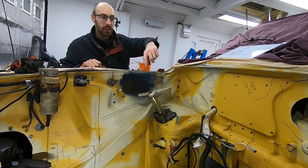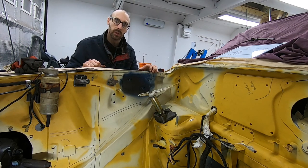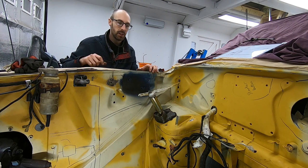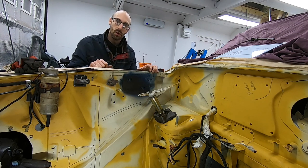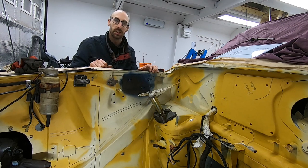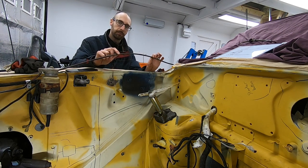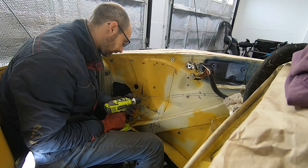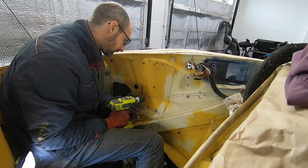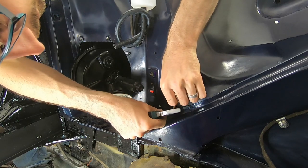The hard line ran up to that point, then it would be a soft jump over to the engine, and you then have a hard line that ran all the way down to the clutch and the gearbox. I think we can tidy up the engine bay a bit and simplify Jaguar's routing by running from here directly down into the tunnel and then having a soft line that jumps across from the chassis onto the gearbox — that will be so much cleaner. And while we're there we can also route this speedo cable. I'm now committing to drilling the holes before the paint, but if I was going to do this again I'd probably make all the lines at this stage and then finalize the holes after. Oh well, lesson learned. Now let's fast forward back to the future and start making some lines.